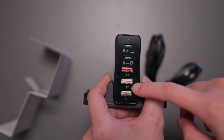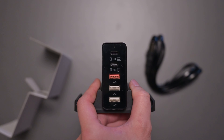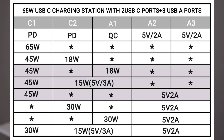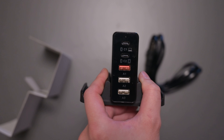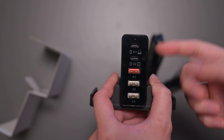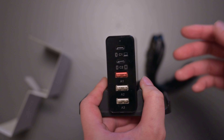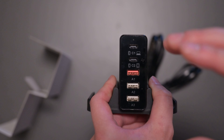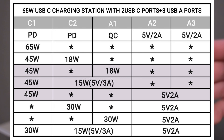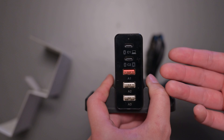The last two ports are plain USB ports that put out around 10 watts at most. I'll put up a table of the different wattage outputs, because this thing can put out 65 watts into one port, but if you're using multiple ports simultaneously it can't put out the maximum through all of them, or else it would overheat. They provide a table showing how much power it puts out in each different port configuration, which is really nice.